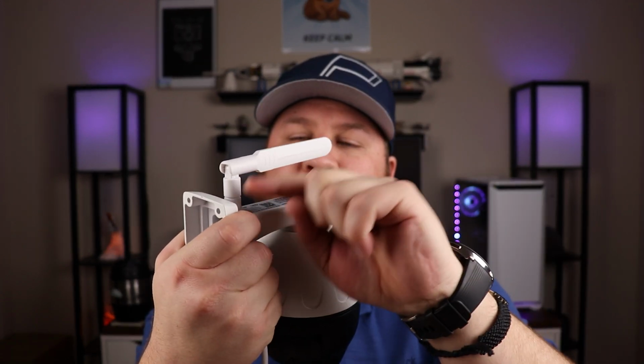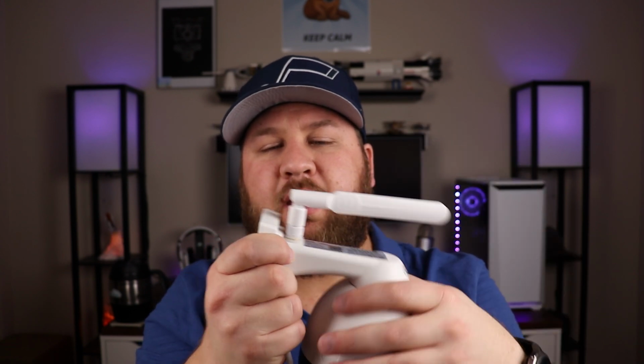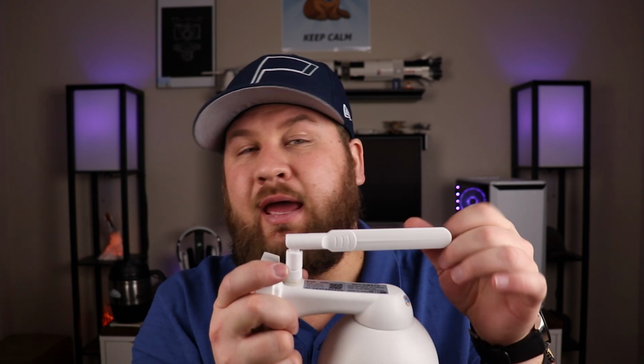I mean, even putting in the screws, you could have a long screwdriver that can mount it. So maybe even moving the antenna. Another thing is, including with that antenna underneath in there, there is no weather sealing on the backside here, but there are some gold contacts of the antenna itself. And so depending on your environment, you may have a lot of moisture or something that may end up causing some corrosion and may end up preventing the wireless function to work at a later date. So maybe just move the whole antenna assembly onto this core. That way you can run it with inside.